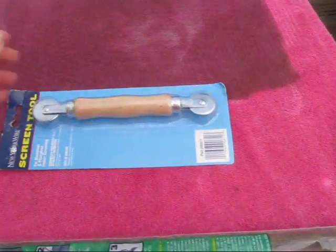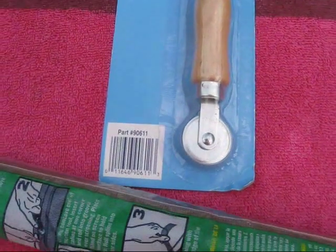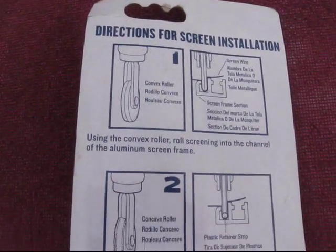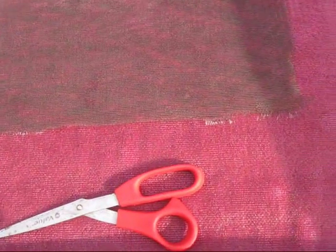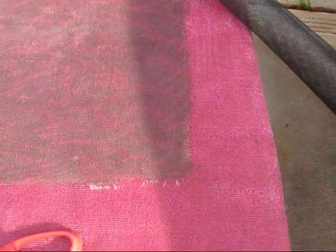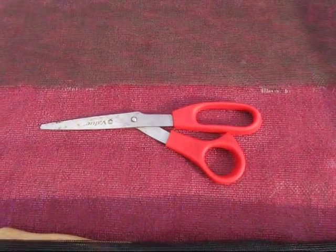This is the screen tool that I will be using. I bought this last year because her daughter also went through the screen door going back inside of the RV. I'm going to take the easy way out on this — here's my old piece laid on top of the new sheet of screen fabric and I will cut just a little bit outside the edges, probably about three quarters of an inch, just so I have enough screen left to get it back in with the rubber stripping stuff.